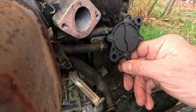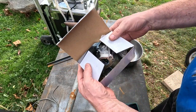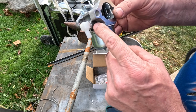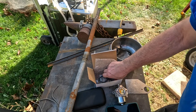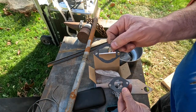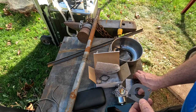I'm going to leave the little red cap on there until I get the carburetor installed. This is the brand new carburetor — it comes in a completely unmarked box, which should tell you something. Nice and shiny new. This is different from the original: that's a metal tube that comes out; this one's a right-angle plastic or nylon fitting. Everything else looks the same. In the box they give you two gaskets — this is the outer gasket that goes against the air cleaner housing, and this is the inner gasket with some non-round holes.